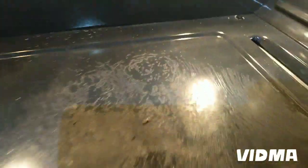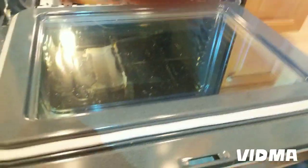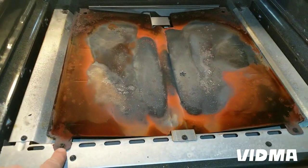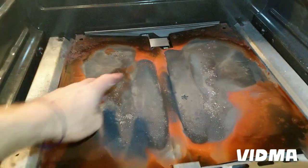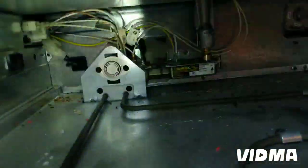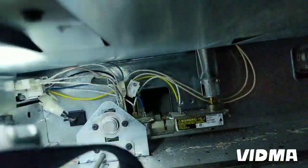So to get the igniter out, these guys here, pop this lid off, and then I'll show you how it looks inside. So always unplug the appliance and turn the gas off when you're doing this. And to get the igniter, you take these guys out, and this thing will pop off, and I will see the burner manifold and the igniter is gonna be on this little bracket. Okay, so this one I can't get to the plug. It's hard to pull out the oven, but there's the main plug. I just disconnected it there. So I'm not getting any power to it.